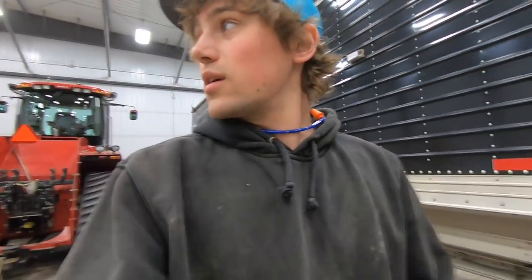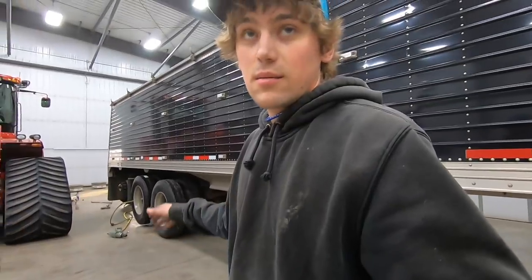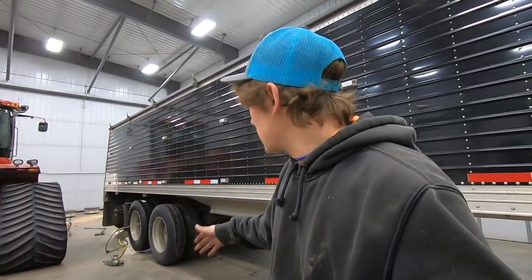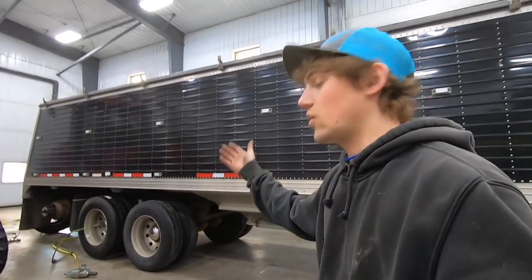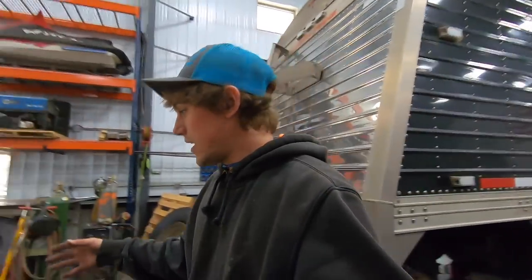Parts could go flying around. So I normally don't just hang around by them as they're pumping for that reason. Also, just stay away from it. You can literally stand 20 feet away and just see the level of the color of the eyeball there, of the cat eye, and know if it's pumped up or not. But I've never had one explode. That's not saying I've ever had a flame ball come out of a tire like that either.